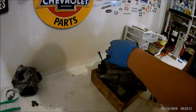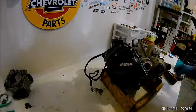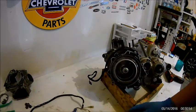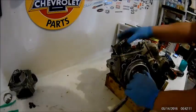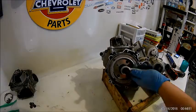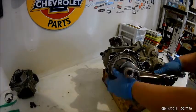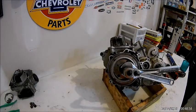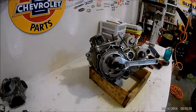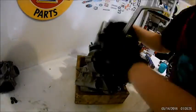Back to the rebuild. We're gonna take off the base gasket. Then we're gonna go to the flywheel side or the stator side — take off that cover, a few bolts. Then take off the flywheel lock nut. This is where you're gonna need that special tool, the flywheel puller, so make sure that fits your flywheel threads. You're gonna hold that with a wrench, then turn in the screw and it should just pop off. You're not supposed to use the air hammer, but I'm pretty weak — it should come right off. And then take off that starter gear.